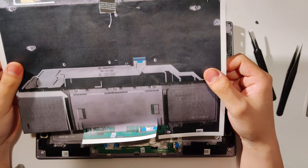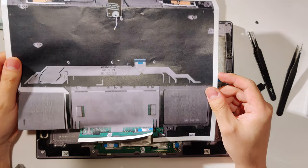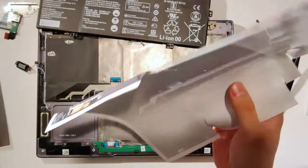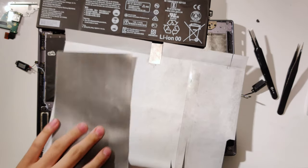The link in the description is a PDF of the scan of the laptop's chassis, printed out at actual scale to use as your cutting stencil. This has been flipped horizontally so that when you attach the graphite sheet to the back of the paper and cut it, it'll be exactly correct for the laptop.